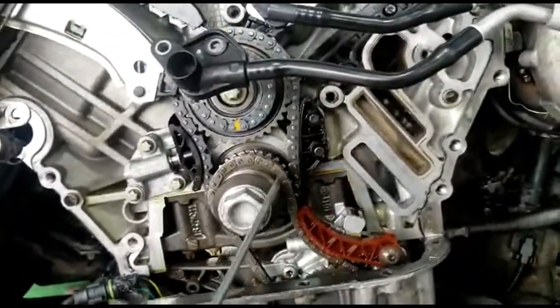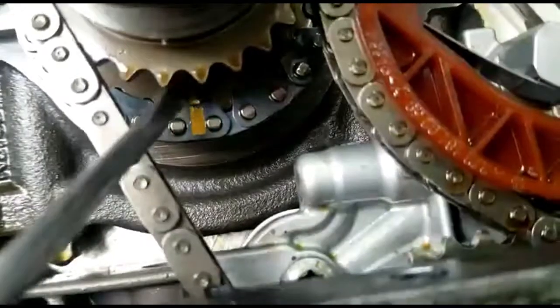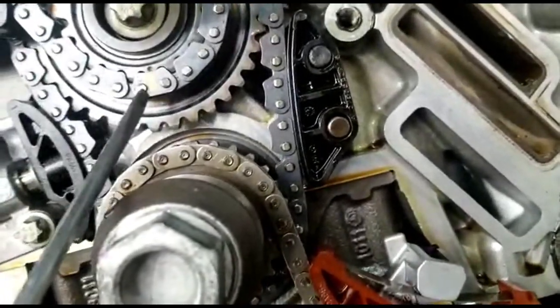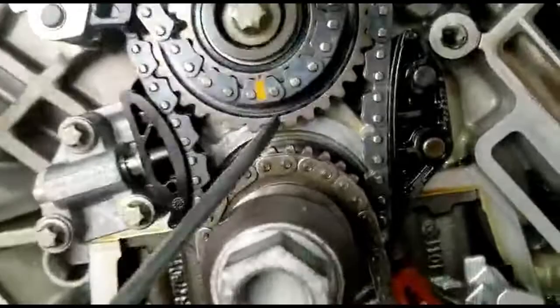You can see it - you put it like that, you cannot go wrong on this one. For the oil pump chain, you don't touch that one. This one here has a pin and a mark - you see it here. You put it at the six o'clock position. Also the top cam - you have to take this bolt off, it will come out. It has a mark here - you put it at six o'clock, and this one at 12 o'clock position. This one goes from the bottom and this one goes from the top. Then the timing chain here - you put the mark on the bottom for the left head, and you put the two marks on top.